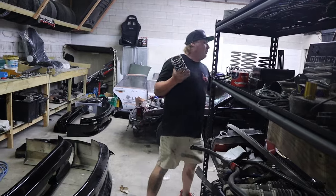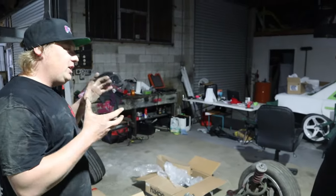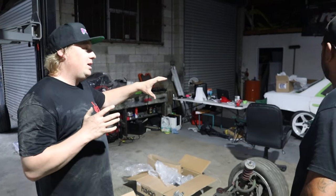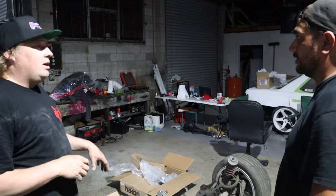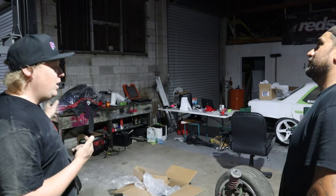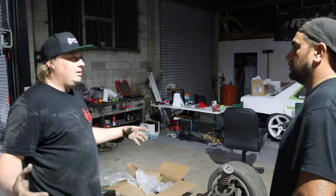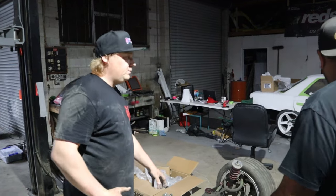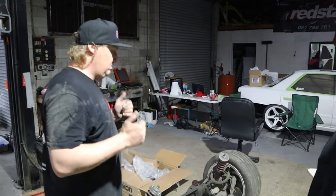Should we just put 12k springs in the front of it? Yeah, that'll be better. That subframe has the GK Tech drop knuckles but for a car like this, it's got factory knuckles — if we break something I'd rather have factory. We've got heaps of factory ones. The top knuckle is good to run but this car can't go low because of the guards anyway. The GK Tech ones are expensive whereas factory ones you can just easily swap in if something happens. Harkon have given us everything we need to make this work — caster arms for the front, camber arms too. Let's go.